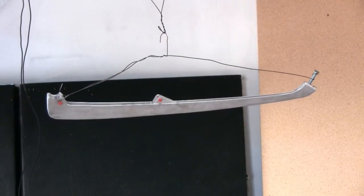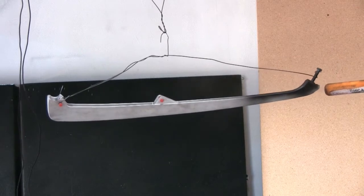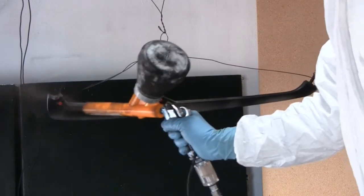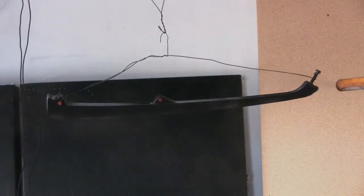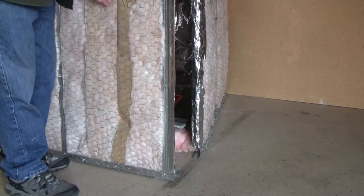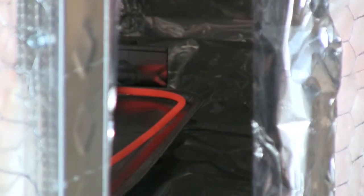I'm on my last part now. I'll fit this in the oven, get it baked, and then start on the next 28-inch frame. This is going very quickly, and I want to get both frames reassembled today. I'm glad we got an early start this morning and didn't wait on completely finishing the oven — this is going so smoothly. These inexpensive powder coat guns work great, are easy to use, and the only maintenance needed is blowing out the gun when you're finished. After powder coating, the timpani frame struts, bases, and crowns are baked and cured in the oven at 375 degrees Fahrenheit for 15 minutes. Let's take a quick peek inside the oven — I'll only open the door a little bit so I don't let all the heat out, but you can still see one of the heating elements glowing red hot. This oven is working extremely well and the results have been perfect.